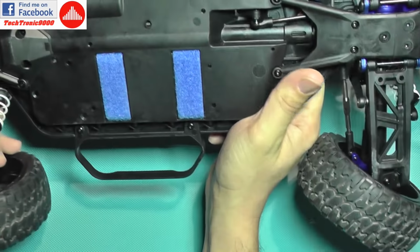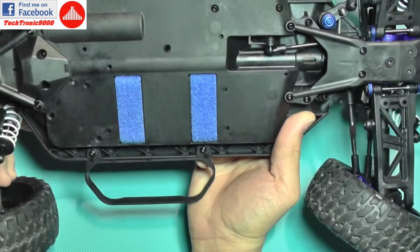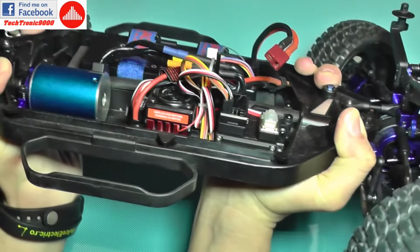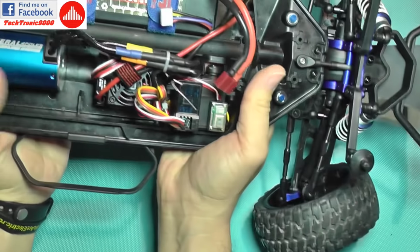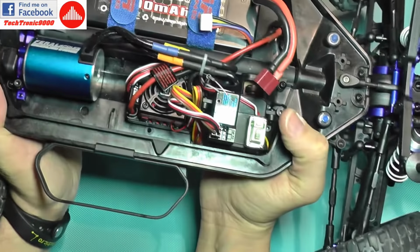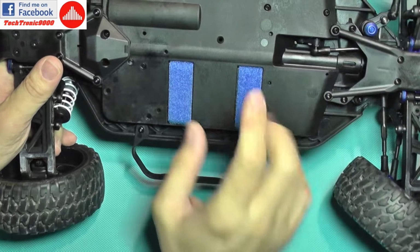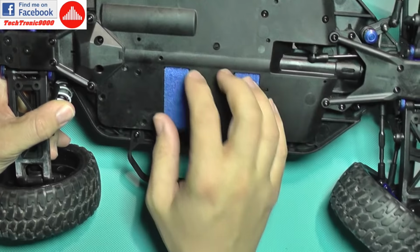The body is made out of plastic, the same type of plastic that was on the Bison, and it has the same shape, and probably it's actually the same chassis. That should be interesting because the Bison had real issues with the chassis cracking and flexing in this area, because it's plastic and doesn't have any kind of reinforcement, so it can always crack. This one is made from a stiffer plastic than the one on the Bison. The Bison chassis is very soft, you can flex it with your hands. This one is harder to flex, and it does have metal mounts for the suspension, so you can always do the rod mod and reinforce it. Also, if the chassis is the same as on the Bison, you can now buy the metal reinforcement plate that you can fit yourself underneath, and it will reinforce this a lot more.